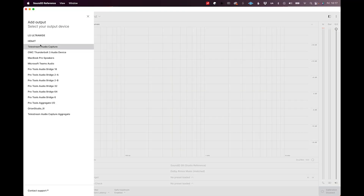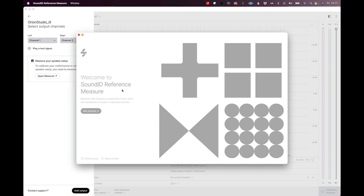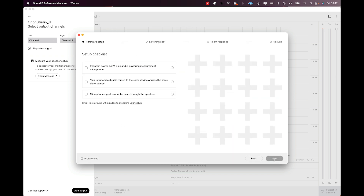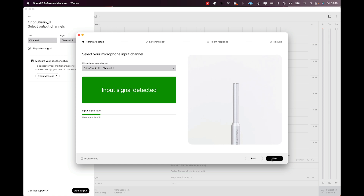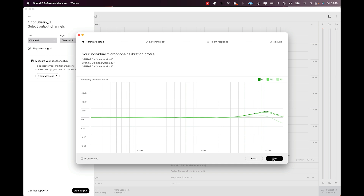I'm connecting the USB port of the Image 2s to my Mac and installing the Fluid Audio DSP configuration tool, setting the speakers to measurement mode, meaning no previous EQ or calibration is being applied. The Sonarworks calibration process takes about 30 minutes and is a two-stage process. First, it calculates where the speakers are with regard to each other and the listening position. Then it uses swept sine wave measurement at 38 positions at or around the listening position sweet spot to generate an EQ curve that balances out any issues in the room. You don't need to see the entire process as it would be the dullest 30 minutes of YouTube video ever.